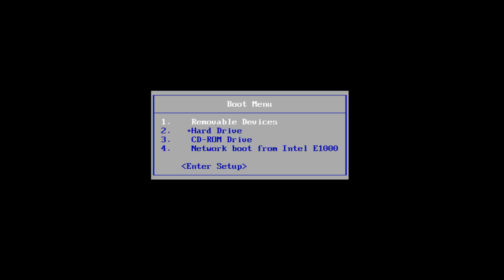Depending on your computer's motherboard specifications, it's a little bit different on exactly how to get to the boot menu, and it might look a little different. Generally it's going to be the Escape key or the F2 key — I'm using the Escape key to get to the boot menu here. I'm going to boot my computer off the CD-ROM drive. You can go into your BIOS settings and change the boot order to boot off your DVD or optical drive first, but I'd recommend using the boot menu since it's a quicker one-time deal and you don't have to go back into BIOS later to change settings back.